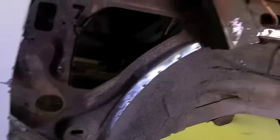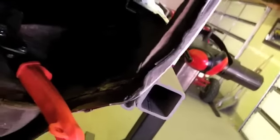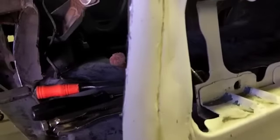So I may try and go ahead and, since the metal's not full of bondo here, section this side the way I had planned to do the other side and see how it turns out — I think it'll be pretty nice. The back here, you can see it's all banged up and just full of bondo. That's easily a quarter of an inch, maybe even a hair thicker. I'll clean all that off and see if I can clean all the bondo and crap out of here, then hammer and dolly it and see what I can do.